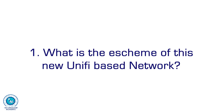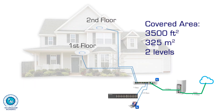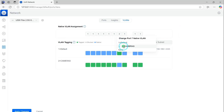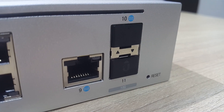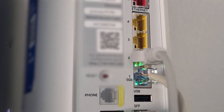Right to the point — we'll be deploying a typical scenario in which two access points are located and distributed for spaces of up to two floors, with sufficient coverage for extended spaces. A switch provides Power over Ethernet to those access points and can also manage logical network divisions to increase security. This is also a very useful scenario for hotspots. We will isolate two ports in a vulnerable position so they only have access to the internet and not to our network — they are practically outside the house. We're also not going to involve any of the UniFi gateways; we'll use the one the internet service provider has installed, in this case AT&T — something very typical in many countries.